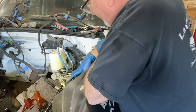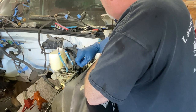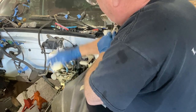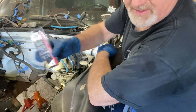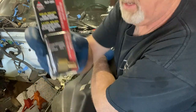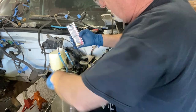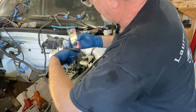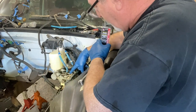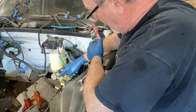The lines coming off the ABS will be plumbed back into the master cylinder. The front line is bigger than the master cylinder hole, so you need an adapter. The adapter I'm using is a BLF-26C — you can get that at the auto parts store for a few bucks. It goes onto the line so the smaller side fits into the master cylinder. The smaller rear line will already fit, so you only need the adapter for the front line.